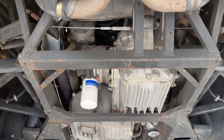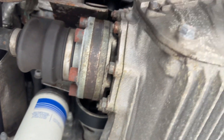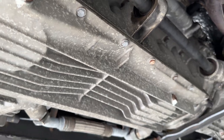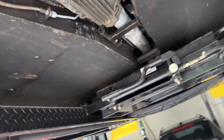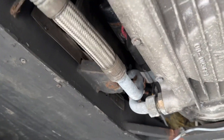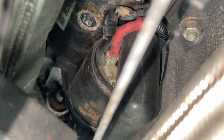She's up in the air and actually it doesn't look too bad. Oil filter is nice and accessible. I'll have to look up the oil change procedure again, but I should probably do diff fluid and stuff like that on these too. Looks like drain and fill, easily accessible — multiple drain plugs, all marked. Center transfer case is all marked up, and there is a fill. I guess that's trans and transfer case. The starter solenoid, luckily, is on the bottom side of everything, so I don't actually think that's going to be terrible. I just hope the starter itself is okay — that is a very big and very expensive piece of equipment.